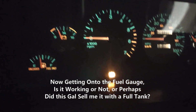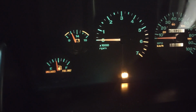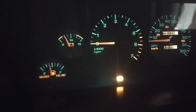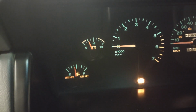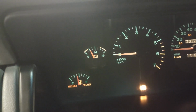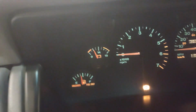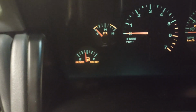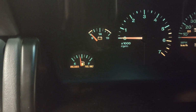Okay, so like doing the oil pressure sender, I used that 33 ohm resistor and put it in between the two lines on the test here that it tells you can do, and I'm reading normal on the gauge. So I know my gauge works. The harness works all the way to the sender. So crawling underneath, up above the rear diff between the tank, there's a plug. You can unplug it, and let me turn the key off now. This migrates down a lot slower than the oil pressure gauge. It may actually stay there.